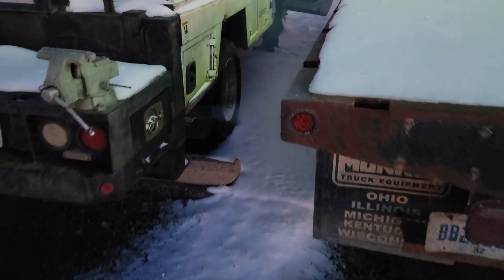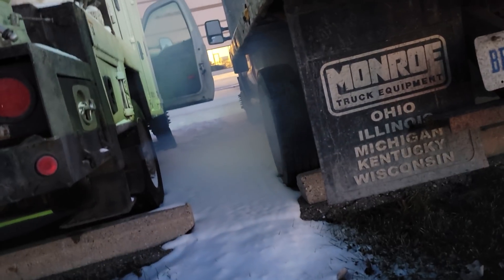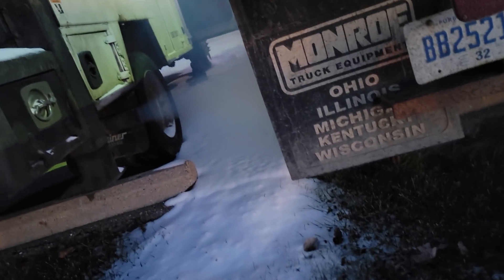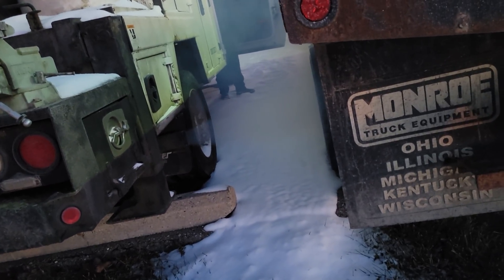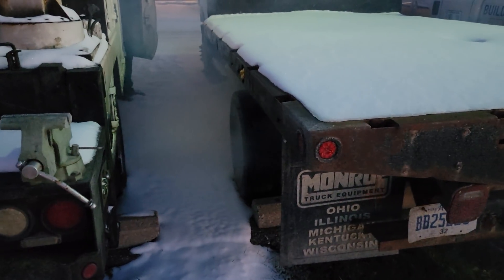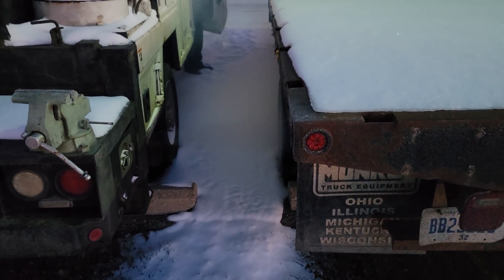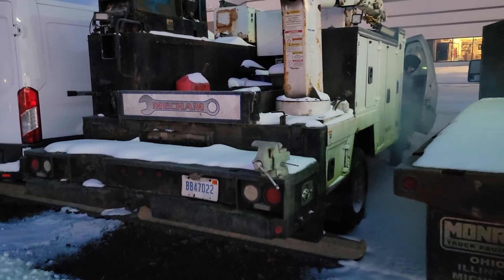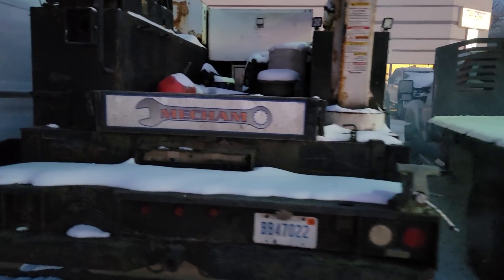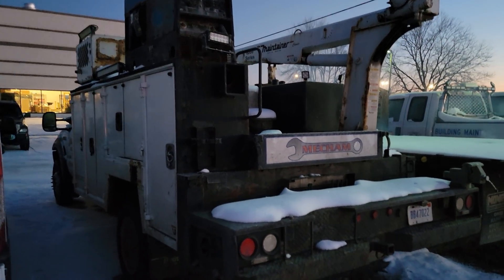She fired right up, no problems! Let's get this thing cranking and go look at the tailpipe. Okay, we got some light smoke - you guys can see the color against the tire. Looks like normal cold-start smoke. Gray-white smoke is an indication of cylinder temp too low. You can hear the turbo spool up!